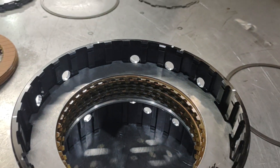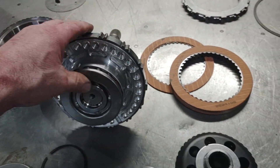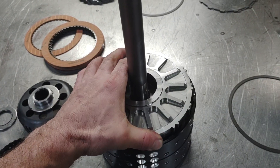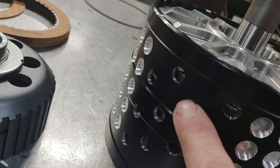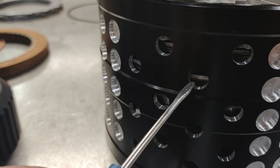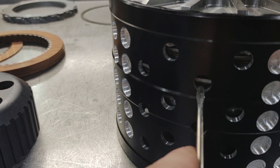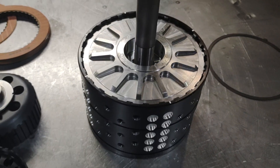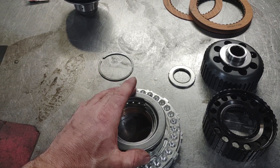Go ahead and put our other 60-thousandths on top. You can kind of see the area of the drum where there's a step, and then we should be able to put the forward clutch housing in on top of that. Check our clearance and put our snap ring in. It's pretty easy to check clearance once you have the holes on the side — you can see how much your clutches move from these holes right here. On a forward clutch it can be a little on the tighter side, so that was probably good. I'll check it off-camera where I can see better.